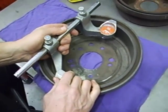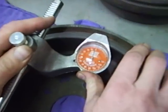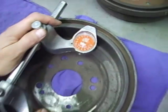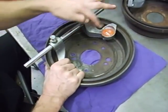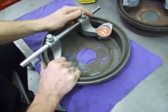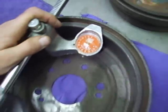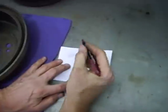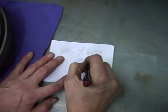I'm going to bring the micrometer onto the drum now. If it was exactly on zero, that'd be a nine and a half inch drum exactly, but there's been some wear on this drum. I'm going to grab hold of the drum mic right here, kind of pushing it against the drum, and simply rock the drum micrometer back and forth. Can you see that reading? We're out there about 18 to 20 thousandths. So my dimension for this drum: 9.5 is what I set the drum micrometer for, plus an additional 20 thousandths — so it's 9.520.